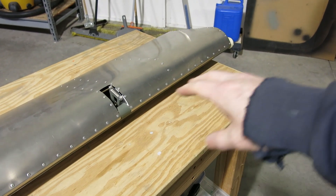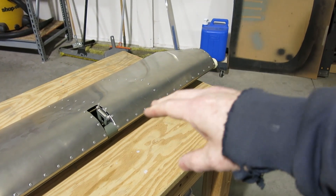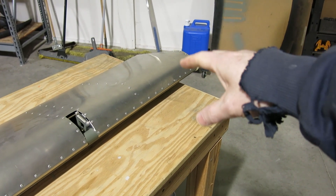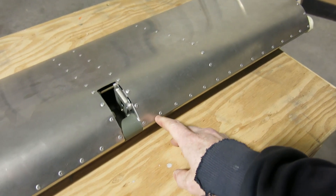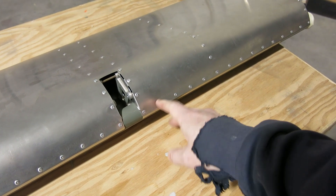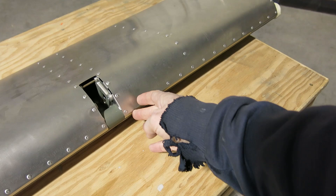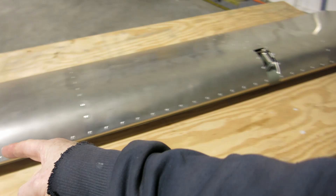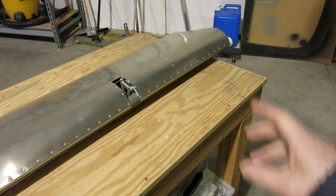So I decided we'll pop that foam out of there, redo that, and just get a little more foam in there so it kind of holds it a little more steady. What happened was I took the foam off, we poured the lead out, and discovered that the plug was very thin on one side — I could see daylight through it. It wasn't all the way through, but there was just a membrane of a bubble, and if that eventually wore, that lead would start coming out all the way down and could roll out the end of the aileron.